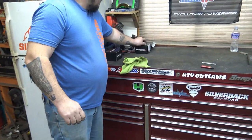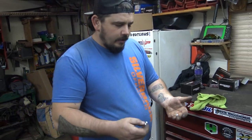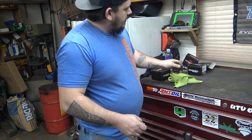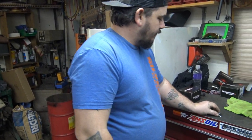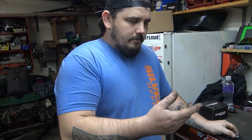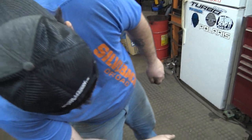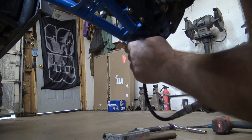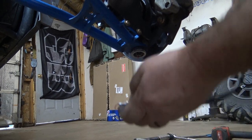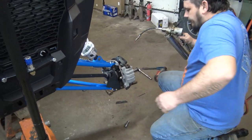So now really it's grease all four. No more extra parts here besides the old bent-up pin we're not going to use. Let me grab this little greaser — here's the one it comes with, here's both. So every two ball joints, you buy them as a pair. What were they, like $125 bucks a pair? Yeah, so if you have two ball joints, it comes with a grease fitting and a needle greaser. If you wear out two ball joints, you can just buy two at a time — you don't have to buy all four. For a good ball joint, you can't beat it. I think that's a good price. And they give you this — that's the hardest part. You get these and people are like, what is this? Well, it's a grease fitting, but how do I use it? So we're going to go ahead and demonstrate the little greaser. My grease gun is hiding right there. This should be a lot easier. There's that — we'll go ahead and call it a day there. Get this wiped off.